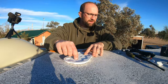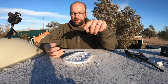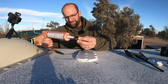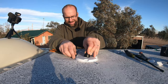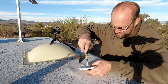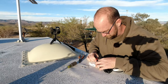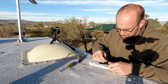There's the plate, and this was a little bit thick. Unfortunately, for the SDR antenna all I could find was one that mounted to a magnetic metal base — I didn't want that so I took all that off. That goes in there. A little bit of sealant — put a little bead around the bottom of that. Since the plastic is pretty thin, I think that'll help hold it. The screw just needs to hold it until it dries. That'll wind up the way I want it. And I'm glad the roof's getting a coating because I'm going to do little bits at a time with my fingers. So that's that antenna.